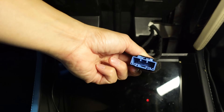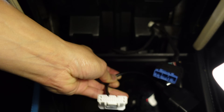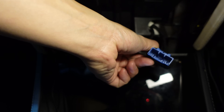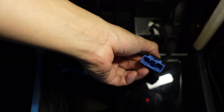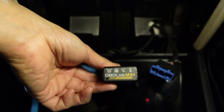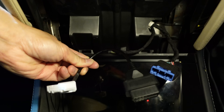It's blue colored in my vehicle, and then you need to buy this harness here — I got this from eBay. Now apparently September 2015 is the cutoff for the different ports. This is a pre-September 2015 port; anything after that you need to buy something else — check the Scan My Tesla website for information. You also need something like the OBD Link MX Plus, which is what I have for iPhone. If you've got an Android device you can get the green one, which is a bit cheaper. This cost me $395 from Amazon and the harness was about $14.